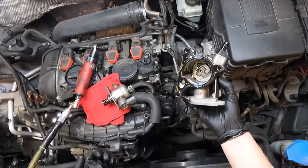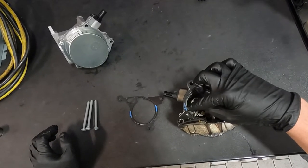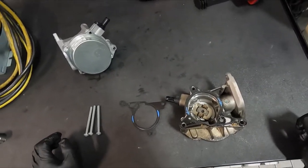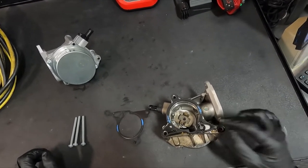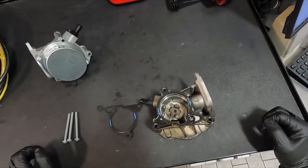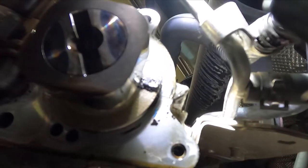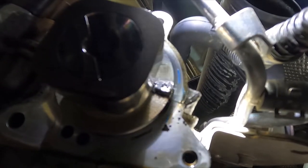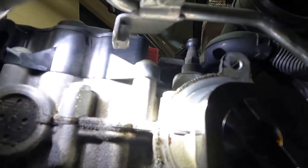And that's it. As you can see, the gasket is still stuck to the vacuum pump. You see this blue right here? That's actually RTV that comes from the factory built onto the gasket. There's going to be a little bit of that left on the side of the engine, so take your pocket screwdriver and very lightly scrape the rest of that off. There's a little bit of blue right there — you just want to get that off and make it a clean surface so that when you put the new gasket on, there are no leaks. There's some on the right side and usually some on the left side as well.